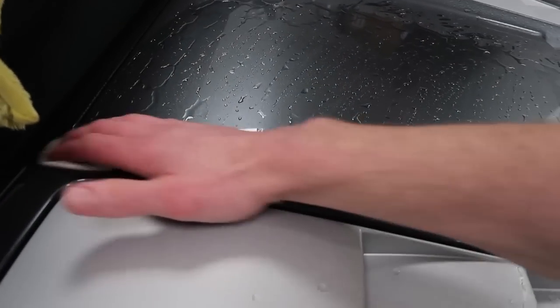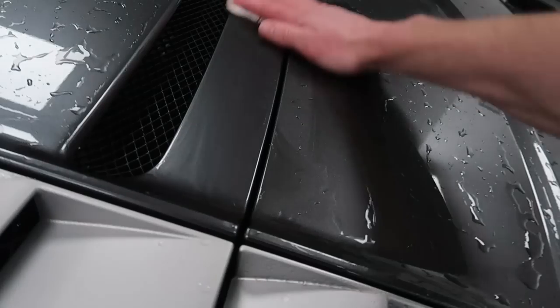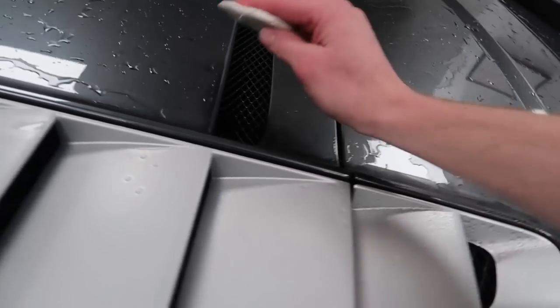A vehicle this size, in this condition, it's probably going to take me 15-20 minutes to get round all surfaces, the glass included, before it's blown dry to eliminate trapped water. And then we're going across onto the ramp behind us, get the wheels off, get them outside for the cleanse, and then start to inspect the paintwork for polishing.